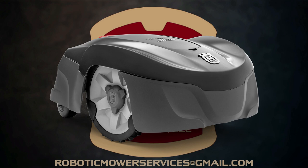One other thing noted by Husqvarna is that the 115H's current-draw system from the wheel motors to sense a collision is less reliable in slippery conditions than the magnetic sensors on the joystick-style units. So anytime anything causes these wheels to slip or have to turn harder or faster, you have the potential for setting off the tilt sensor or the collision sensor system on the 115H.